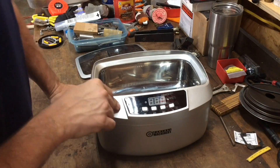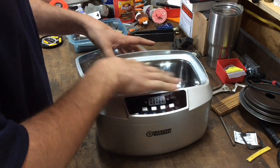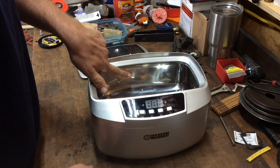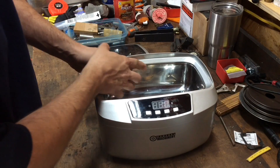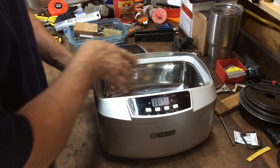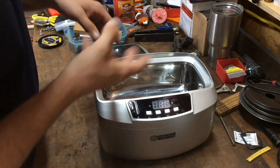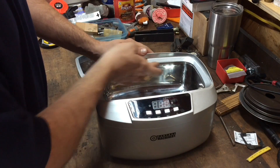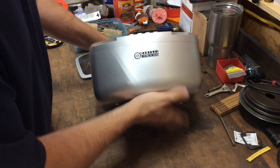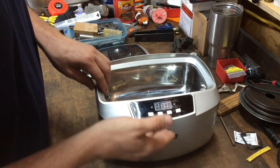I said I've had three — I broke one, one was dead on arrival, and this is number three. How did I break it? When you fill this up with fluid and you want to pour it out, or if you overfill — there's a max fill line, and that's how I broke mine. If you fill it beyond that max fill line, you get water intrusion. You've got this metal bowl and this plastic housing, and in between is a Harbor Freight quality silicone gasket. Water can still get between there, and the control board is just sitting down in the belly of the beast — so you can destroy it. And that's what I did.